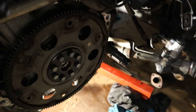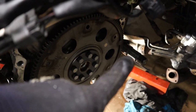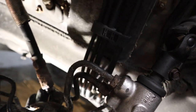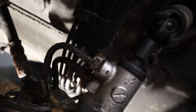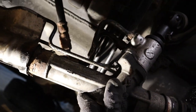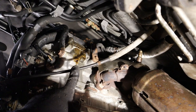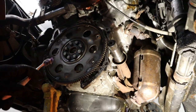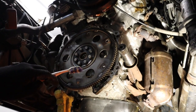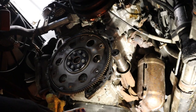There is the passenger side axle that was giving me trouble. Trying to line this thing back up is going to be a real pain because you have to line it up and then rotate it to align it back with the bell housing. Unfortunately the line that got severed was the high pressure line going to the power steering rack — it just couldn't take that much movement when I dropped the subframe down, and it was super rusty. We also have a valve cover leak in the back. Overall given the extra labor, I think it is actually worth it to drop the engine, transmission, and subframe together.